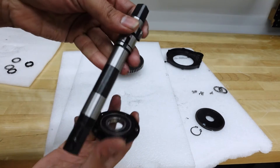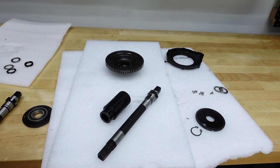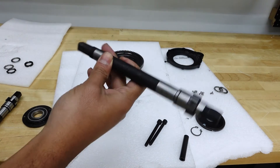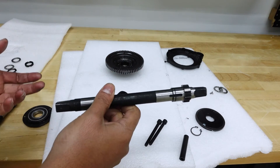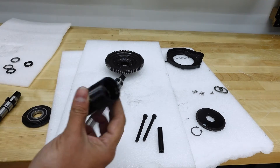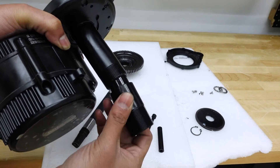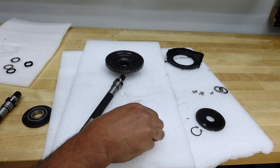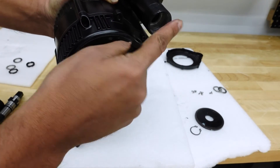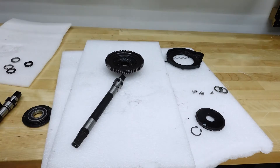So this is the old shaft. I'm converting this motor to 120 millimeter, so here's what the modification kit comes with: two new bigger bolts, two spacers, and a 120 millimeter shaft. If you're doing 100 or 120 millimeter, the size of the bolts and the adapter will change. This adapter basically extends the shaft on the motor. The bolts are for when you're attaching your motor to the motor hanger — since you now have a longer shaft, you need longer bolts to put it on your bike.